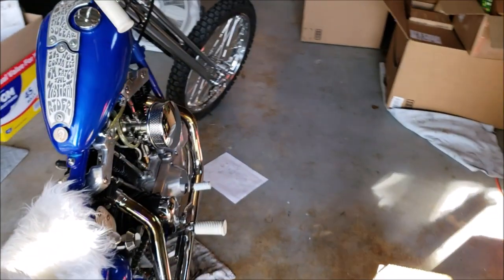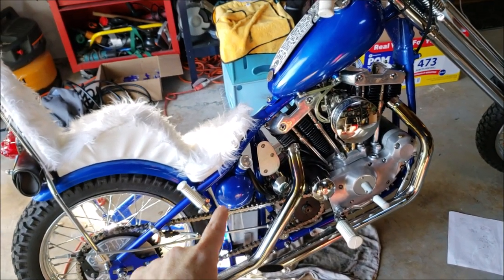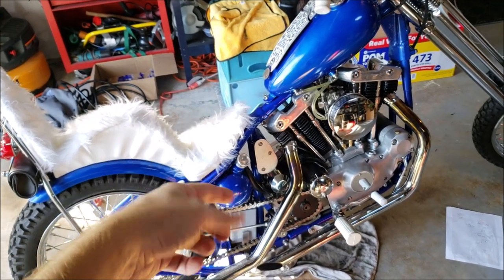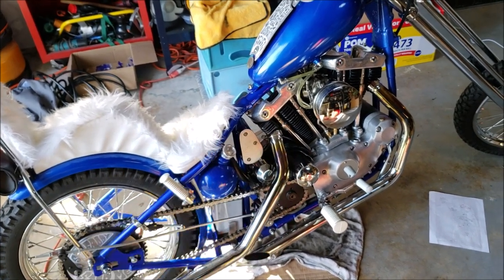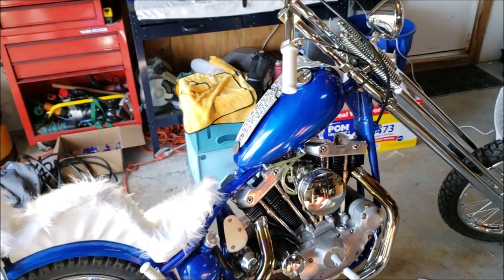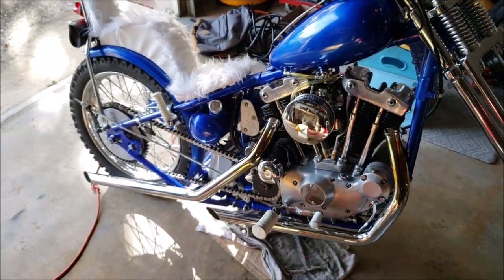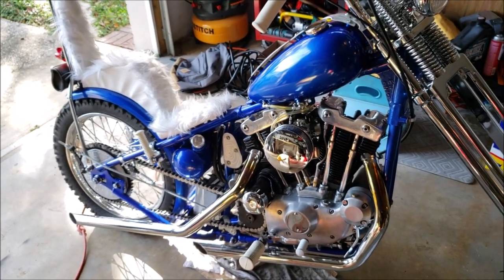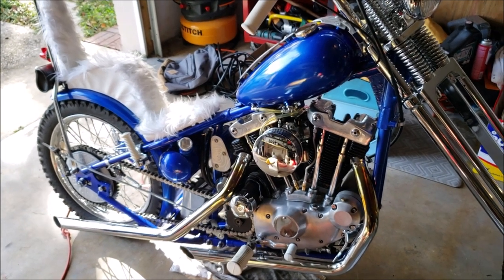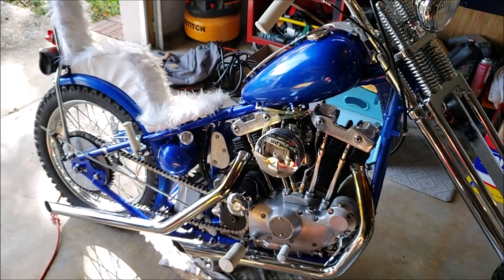That's the overall setup — I wanted to give you an overview first. The next video will go into an actual breakdown of how the engineering on this works, so if you want to do something similar and modify it for your own bike, you'll know everything about setting up a chopper wiring diagram. I'm not running turn signals, speedometer, or a tach — this is a basic chopper wiring diagram. I've been running this for a few months now and it works like a charm: charges well, runs well, it's clean and simple, no shorts.